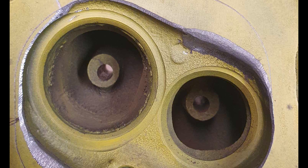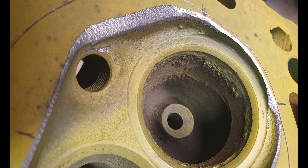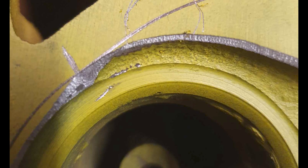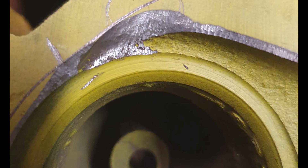This pic shows the exhaust valve on the spark plug side of the combustion chamber — a little bit of work can actually be done in this area, and we will do a little bit of work here. Now this is an overview of what Craig does to every single combustion chamber, even if he's not doing any other shrouding work. Take note of the wide and narrow chamfer around the combustion chamber: the narrow is a basic flat chamfer, and the wider work is a nice gentle radius basically from the top of the combustion chamber to the face of the cylinder head. You can also see the classic nasty detonation area on the intake valve that we want to remove material from to mitigate detonation.